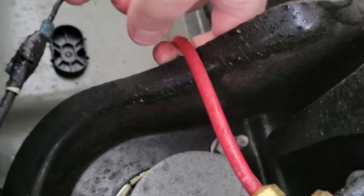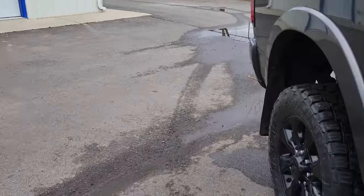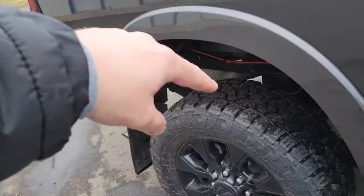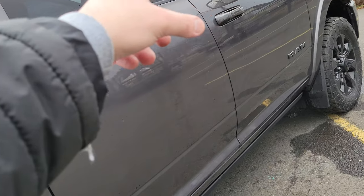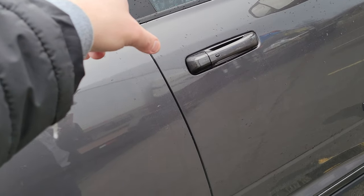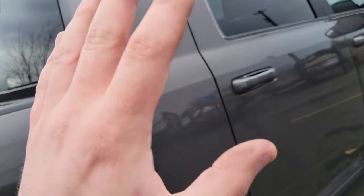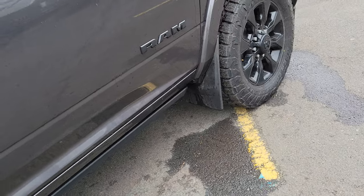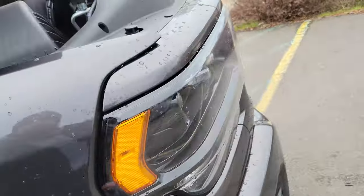This quick connect isn't positioned right — the guy was in a hurry and let it drop, but that'll wear out quick. The main line goes to the switch, crosses through the crossmember — it'll get a little warm, but shouldn't get too toasty. The two airbags have a single line between them, a T going back for quick rear access, and a T forward to the controller. Once air is applied through the controller it goes to the bags, or I can apply it directly via the quick connect. As long as that switch doesn't fail, the airbags are isolated from the tank. Right now I'm turning on the air compressor, getting air in the tank, and adjusting pressure.